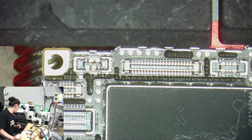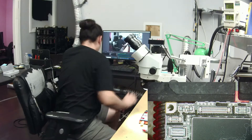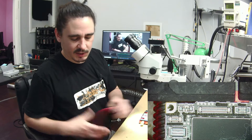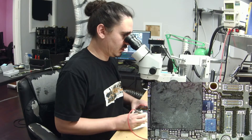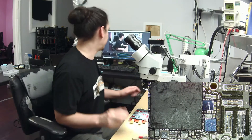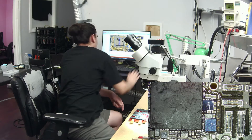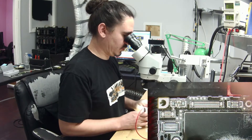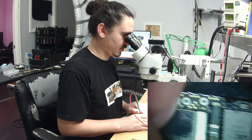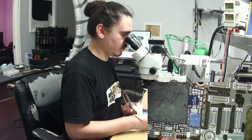So now when I test on my DC power supply, I should see a more normal boot sequence. I'll once again grab my DC power supply probes, connect them to the battery connector, and prompt this phone to boot. I believe this is my power button line — let me double check that. Yeah, that was correct. So these go to the battery connector, and I'll prompt this phone to boot with the power button line.